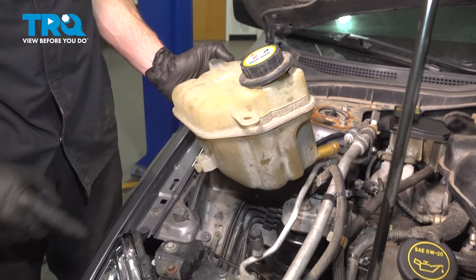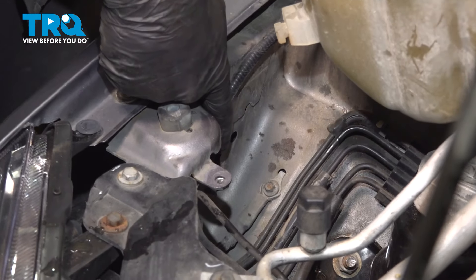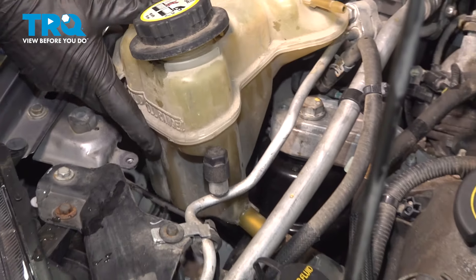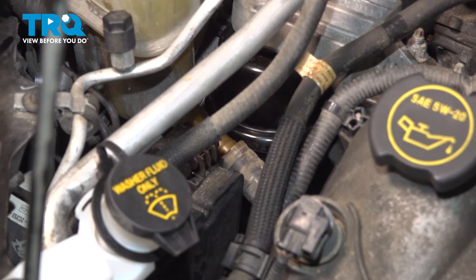Let's get ready for the installation of our reservoir. We'll be paying attention to the mounting point along the side that slides into the fender of the vehicle, and also the other side where the hose will slide onto. Let's start with the hose — bring this down close to proper position, start the hose on there, put the clamp into position and make sure it's nice and tight.